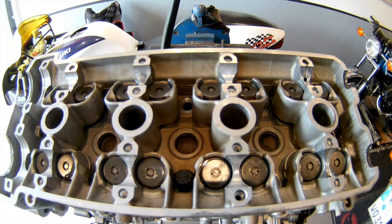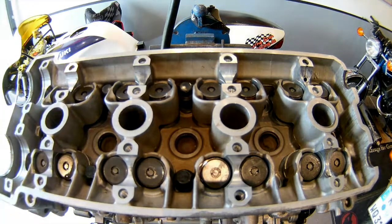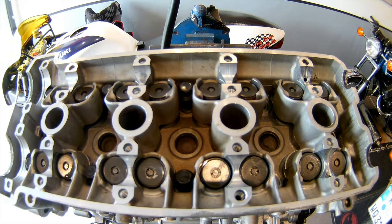Next we have our — I think it's 10 bolt heads, yes, 10 in total. These go just in there. Make sure not to forget the original washers that are on there under these head bolts, and make sure that these washers are lubricated a bit with engine oil. These washers are in there to prevent you from damaging the cylinder head casting while torquing up those bolts. If you lubricate them, it's just going to prevent additional wear on the casting itself. It also says so in the manual.